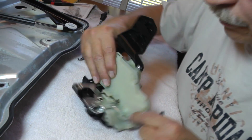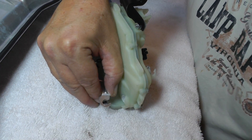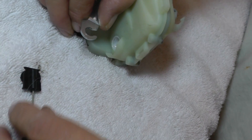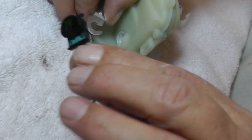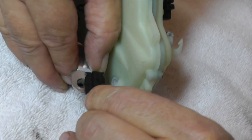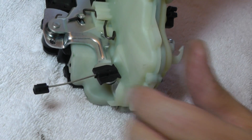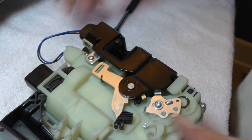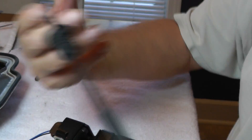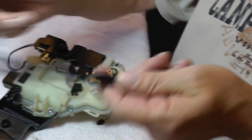First I'm going to pull this lever out. There's the little short cable going to the outside door handle. You can see it's got a groove on the back side — this is the top side. Put it in at an angle, sideways like that, rotate it around, let it come back. Next I'm going to take this bowden cable — it's brand new — and insert it. You can see that the cable moves freely.